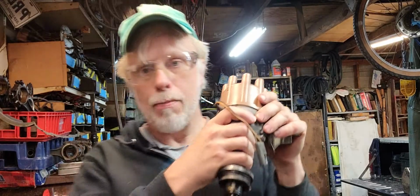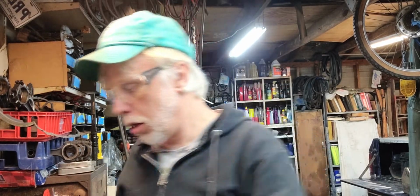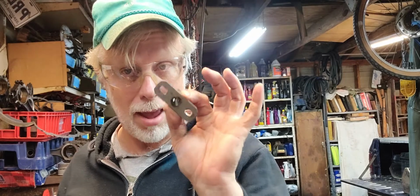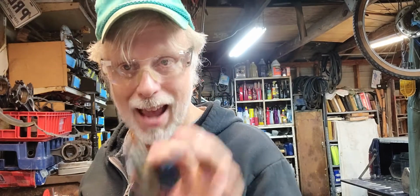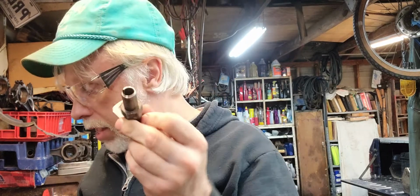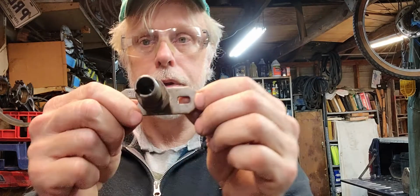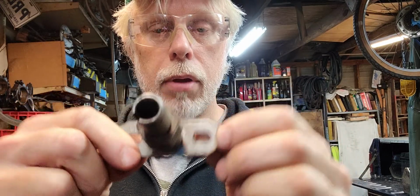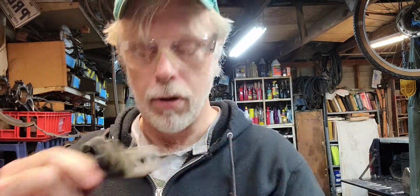So what I will have to do is take a distributor like this, a V8 points distributor, and then find the cam here, the points cam from the slant 6. I think I can swap these out between that V8 distributor and this one here. So then I will have 6 cylinders, okay? And as you can count right there, you'll see 6 points.